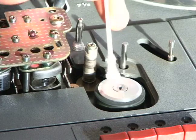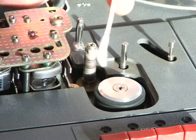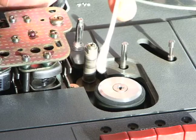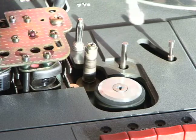So now we're going to be cleaning this pressure roller here and the capstan, which is where this Q-tip is sitting right here, plus the remainder sections for the tape guides, which are contained over on this side — the right side of the tape machine. So let's do that now.